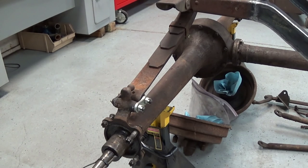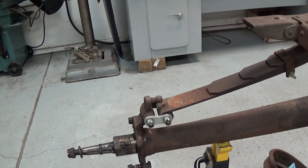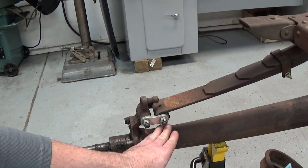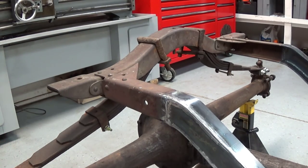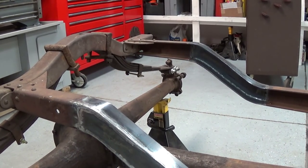The rear leaf spring is a T and the axle is an A — the A shackles work just fine with the T spring, you just have to spread the spring a little bit. They make a spring spreader, but my trick is to put a piece of two-by-four right here so the spring sets in exactly the right place. Have your shackles ready, then run a tie strap between the axle and the frame, jack it down just a little bit so the spring spreads out, and you can slide the bolt right in.